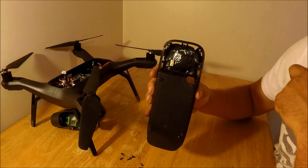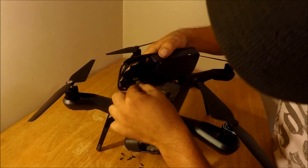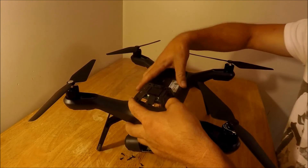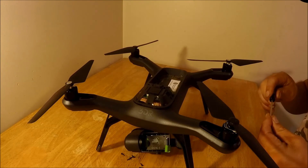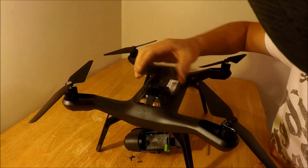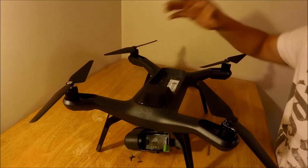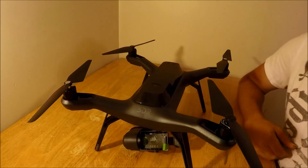Go ahead and connect your two screws that you took out to secure the foil. After you've got those two screws in, connect everything back up — put this cable back in here, slide this tray in, and go ahead and put your seven screws back in. After you put your screws back in, take this cap and put it to the front a little bit, slide it back and it clips right in. Put the battery back in.